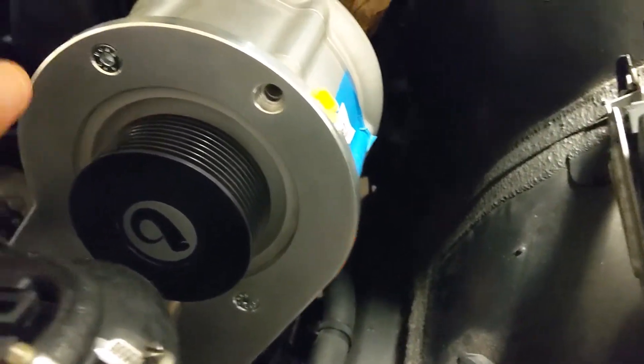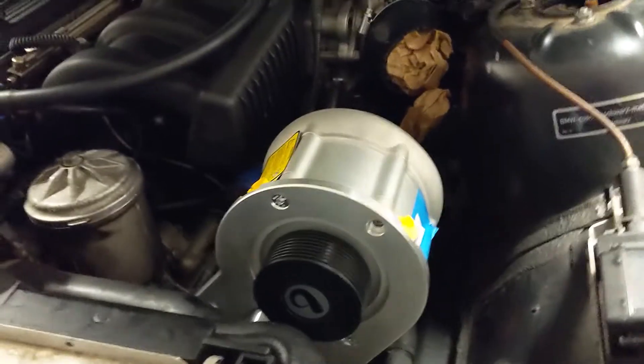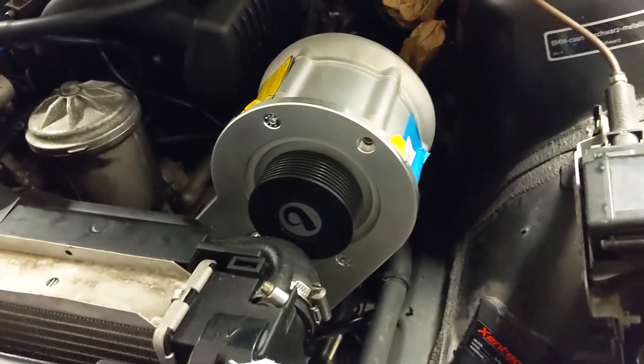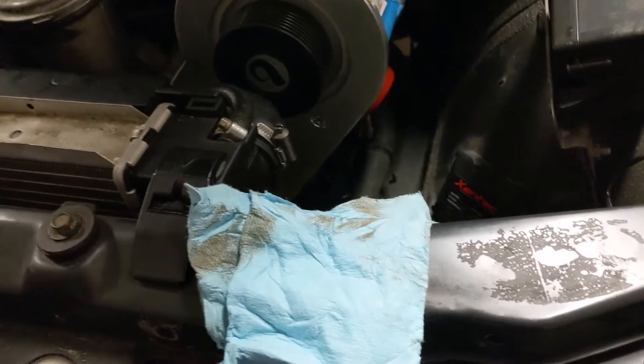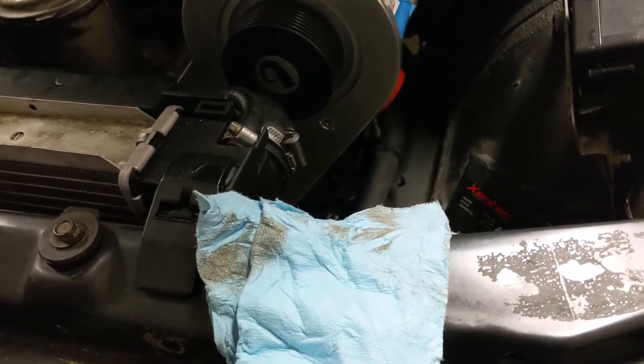I just want to make a quick video with a couple of tips. These two torqued up just fine. The torque value they gave me was 8 foot pounds. I would recommend using an inch-pound torque wrench and going really, really slow. Maybe even use Never Seize — I hadn't seen that recommendation anywhere, but it might help as far as lubricating it as it goes in.